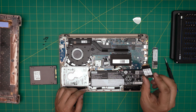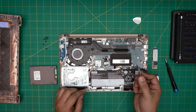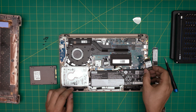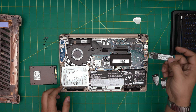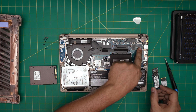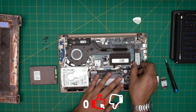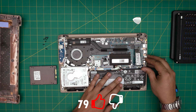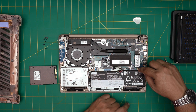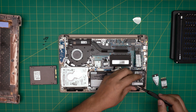There's your 256GB short-profile NVMe — grab a long-profile one instead; I'll leave a link in the description for good ones. To install a long one, make sure the notch matches the slot on the connector. Bring it in at a 10–15 degree angle, push it all the way inside until it clicks, then bring it down so the screw hole lines up snugly, and put the screw in.